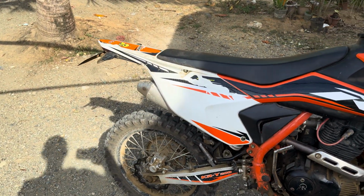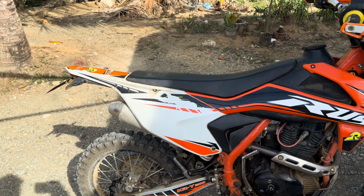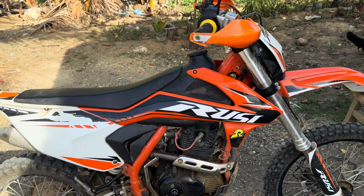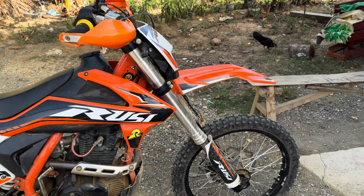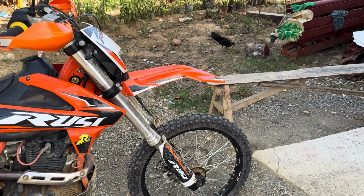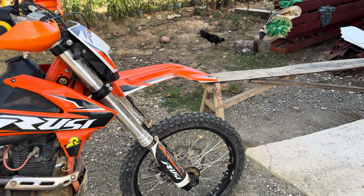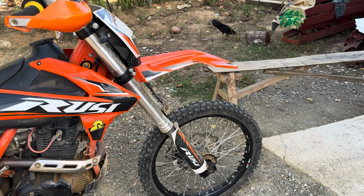and this is a 185 on the back. They usually say on the rim somewhere what size rims you have, so that way you know what tire and rim lock to order. So just match the rim lock with the rim size. So if the rim's a 1.60, you get a 1.60 rim lock, which is what I've done.